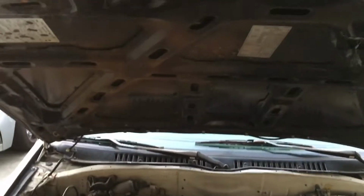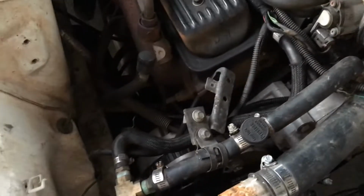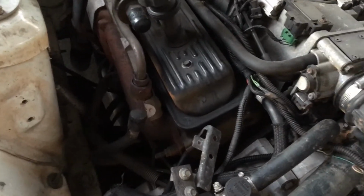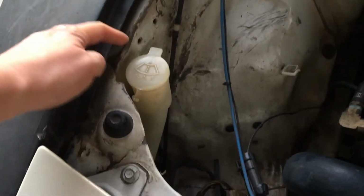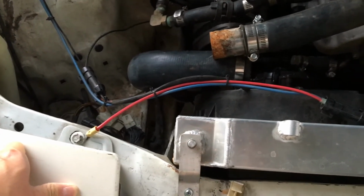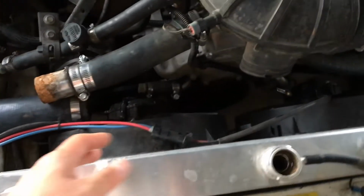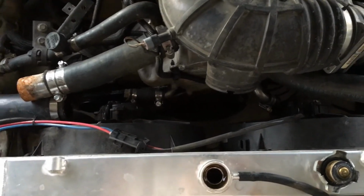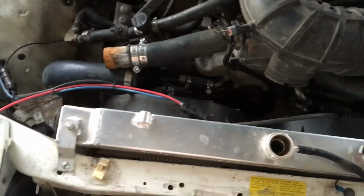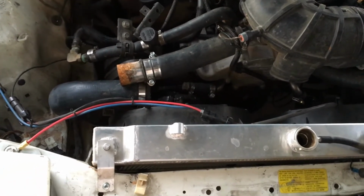And I'm pretty sure there's coolant residual on the front, on the shock tower, and on that passenger's side valve cover. So I'm pretty sure that when this car got hit, and you can see the damage here, the crinkle over here that extends all the way back to the firewall, and why this car consequently has a salvage title now, that hit damaged the existing radiator, the fans. I was running a single fan off of a Fiero, actually. So that was probably knocked loose in the accident. And so the coolant was probably replaced at that point in time.